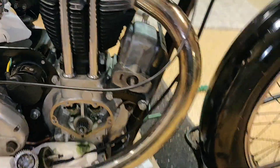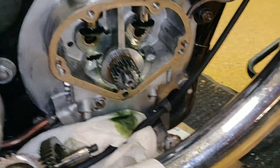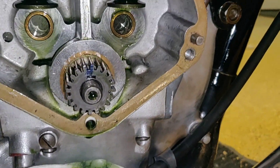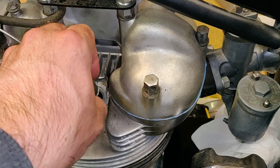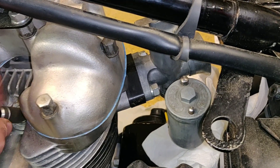The first thing I did was pull everything apart and remove the spark plug. I made sure that I'm in the realm of top dead center — the pinion is pointed straight up, you can see it right there. I'll do a quick sanity check to make sure that's the case, and then put the timing tool in there until I get a chance to do the next part.